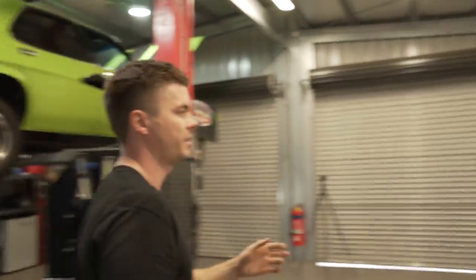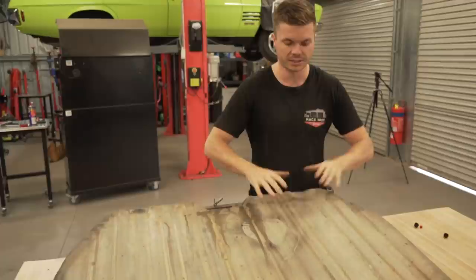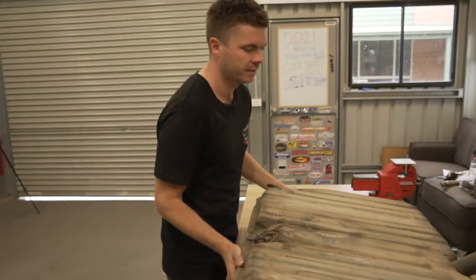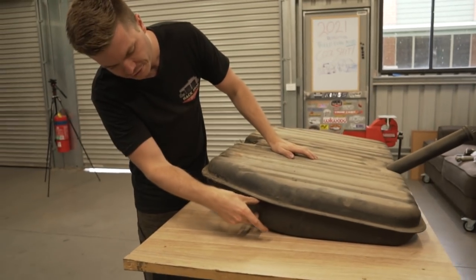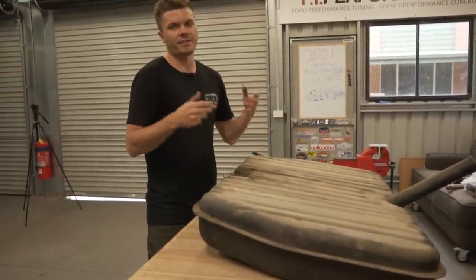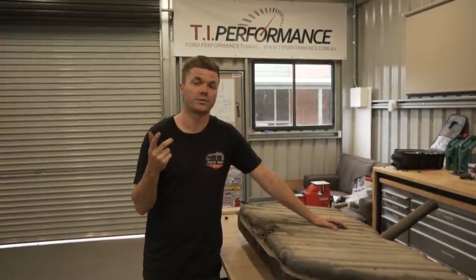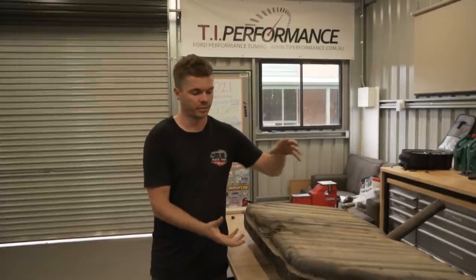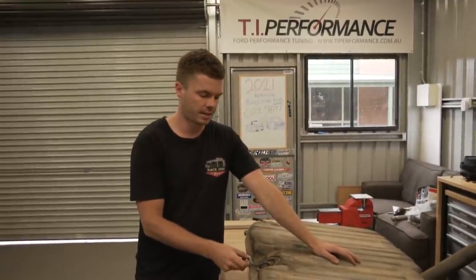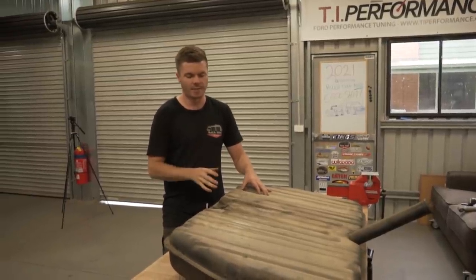What that means is we'll now be looking at modifying the original tank. I wasn't really planning on doing that because HQ tanks are notoriously shallow and it's hard to get a swirl pot and fuel pump into them. There are guys that have done it - I've seen guys put a 50mm spacer in and modify the tank with a nice EFI hanger and swirl pot - but those guys have a lot of fabricating skills, not guys like us. We quickly jumped on the computer and found a company that's fairly local to us that actually sells a kit specifically for HQs - a built-in swirl pot kit that's supposed to fit an HQ tank. We can't call them today because they're closed, so I'll give them a call tomorrow. It does hold us up from finishing the fuel system today, but it is what it is.